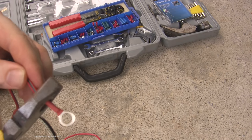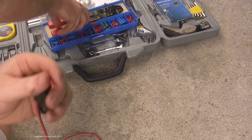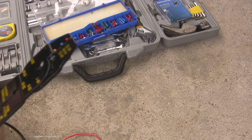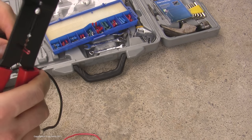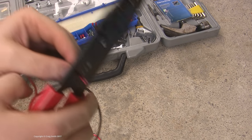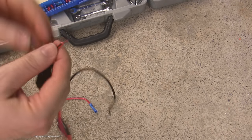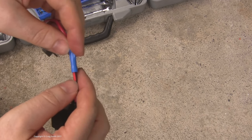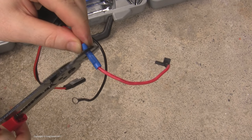When you have access to all the car spaces you'll need, you can get your cabling ready to go in. In my case all I need to do is join my fuse tap to the downstream wiring — the terminal-to-SAE cable I bought. To do crimps you'll obviously need a crimping tool, strip the wire bare, and here I'm using the existing crimp connector that came pre-attached to the fuse tap. You can solder if you prefer, but I like crimps if they're done properly.